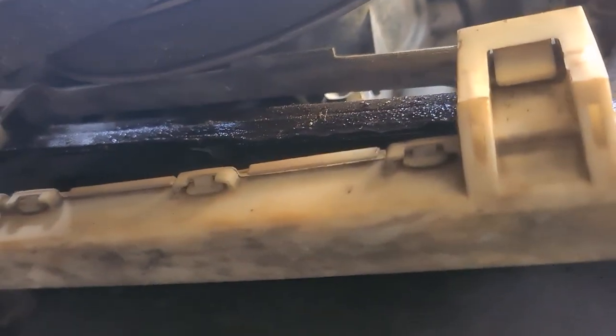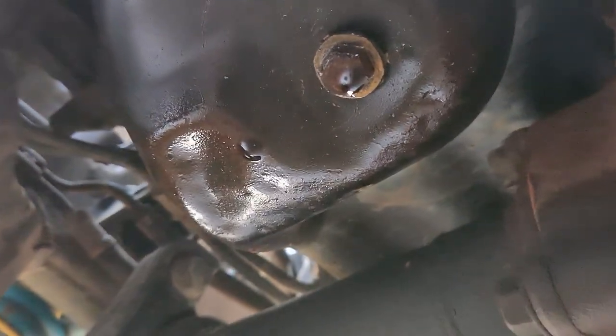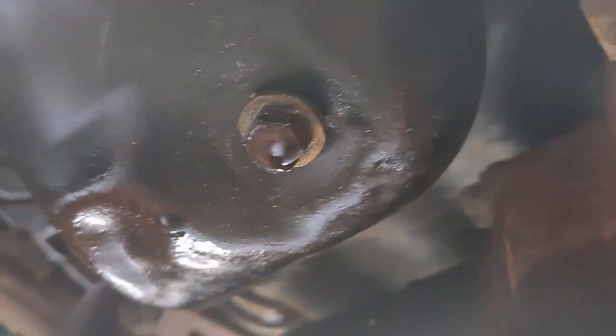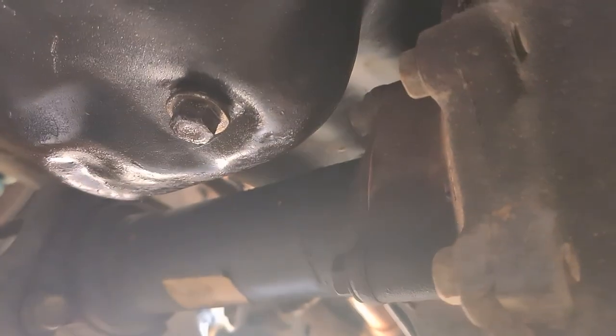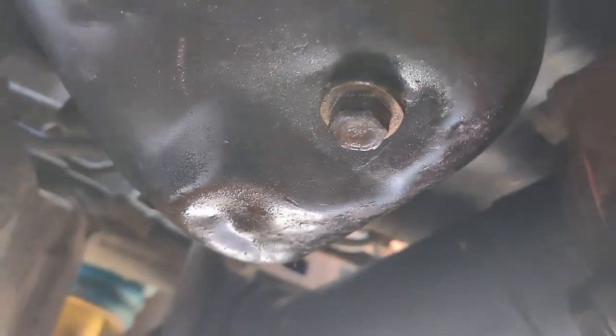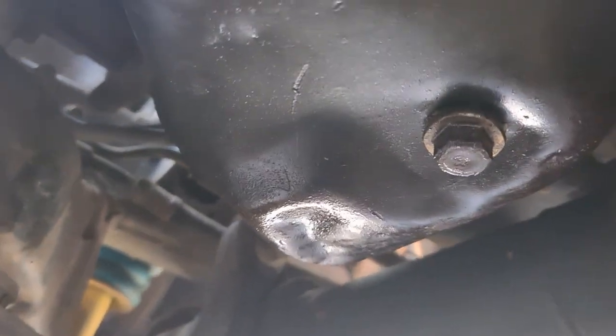If I look up in here you can actually see the gasket for the sump is weeping, so I'll need to replace it at some point. The actual sump bolt plug also appears to have had a bit of a leak as well. I've noticed it's had a bit of a bang here too, so maybe when I do the sump gasket I might just replace the whole sump in one go.